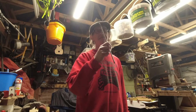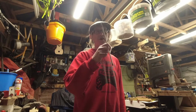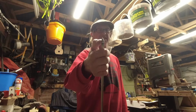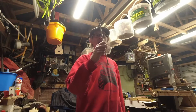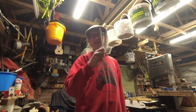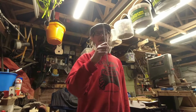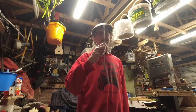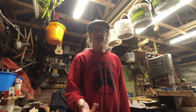I can't find a dimension anywhere off Yamaha or any of the manuals, and I can't get any information on its length. So what I've done is I've deducted the diameter of the bearing off this end, put the shape back on the end of it, so that is now 9mm shorter than it used to be. So theoretically, when I put that in, put the slave on, I should have a clutch once I've bled it, because all I've done is deducted the ball bearing size off this rod. The ball bearing's 8.6, I've taken 9 off it, so I've allowed for a little bit more free play than probably is necessary, but I'll find that out in a bit.